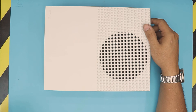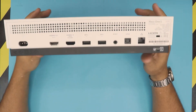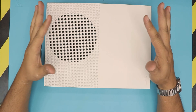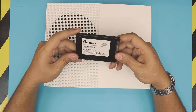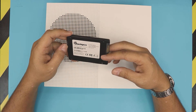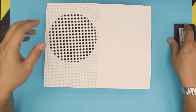In this video I'm going to show you how to speed up your Xbox One and how to do an upgrade. This particular model is an Xbox One S, model 1681, and this applies to any Xbox One S version. To get your games loading fast, improve response time, or boot up faster, we're going to open it up and replace the mechanical hard drive with an SSD. Purchase a regular 2.5-inch SATA solid state drive — I'll leave a link in the description. You can buy 500GB, 1TB, or whatever size you like. Any 2.5-inch SSD will work, even SATA 3.